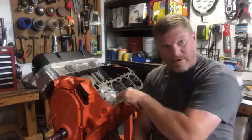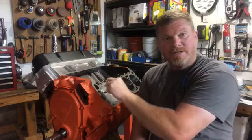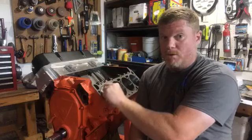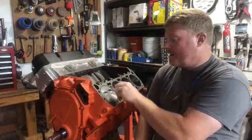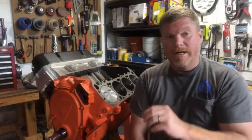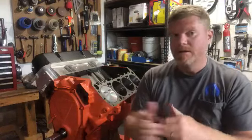Now, what detonation is, is that at a separate point in this cylinder, a second explosion happens. Something causes a second explosion to happen. Something causes that fuel and air to kick off and go. So you have boom, boom, boom, boom, boom, boom. That's knock. That detonation is not in harmony. It's not from the spark, it's from something else. There's a few things that can cause detonation.